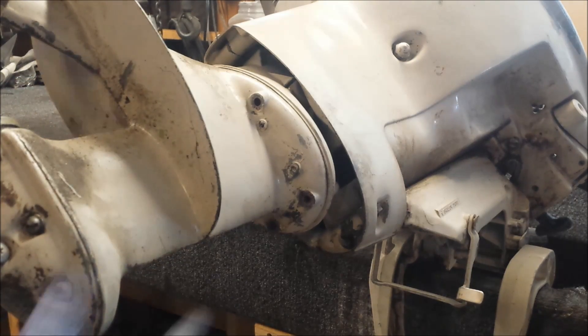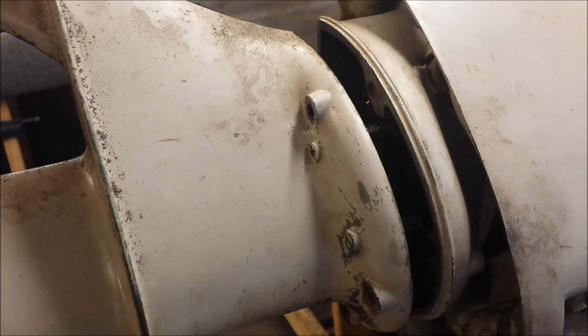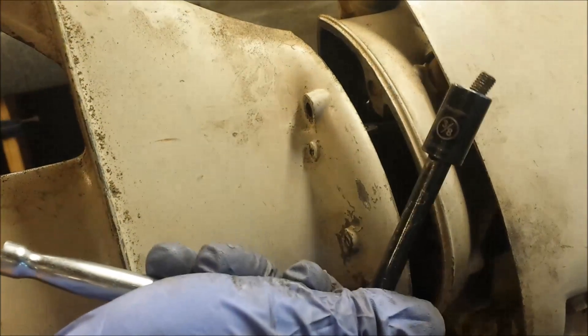Bolts are out. Now we can wheel and slide that on out of there. Drop it down a little bit. Now we can do the shift rod connector - it's got a flat head on it, I'll try that first, but chances are I'll be putting a socket on there. Surprise, it's too tight for the flat head, so I have a 3/8ths inch socket - get that inside of there and use that to crack it loose. When you're doing this there's a very good chance the socket's going to get stuck or the screw's going to fall out. It's a good idea to clean the floor beforehand. I got lucky - the whole thing came out.